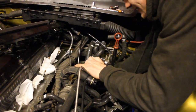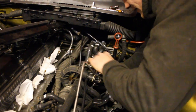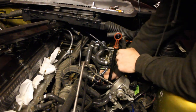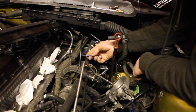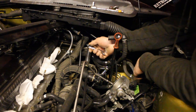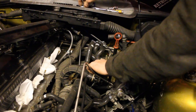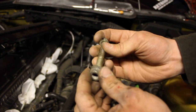The nut is a 16mm and the bolt for it is an inverted torx — I can't remember what size. Rather than jack the car up and go underneath, I'm using a stubby 10mm spanner — Rolson's finest — and using the closed end with the teeth it does actually grip enough to undo it. So you can do it without having to jack the car up, which is quite nice. That's what it looks like: an inverted torx bit with a 16mm nut on it.